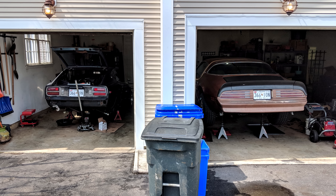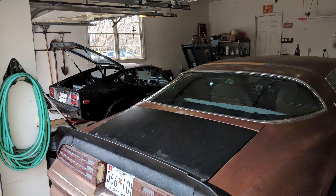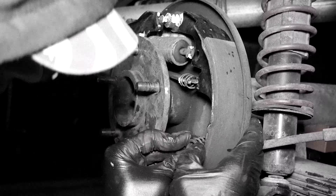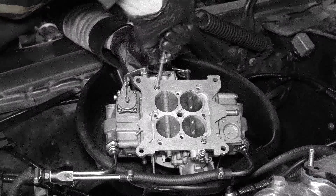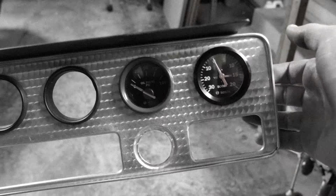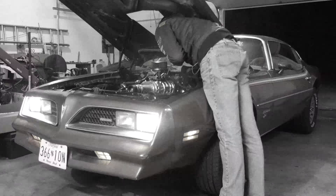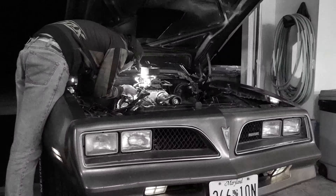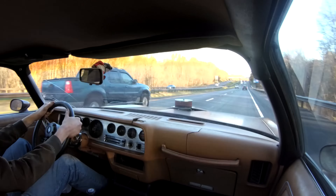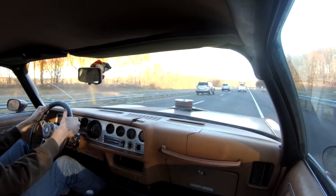But while Sean had always planned to bring the Datsun to this autocross event, I decided to bring my project car, this 1978 Firebird, as well. A small light car like a 280Z really lends itself well to autocross, while something much larger and at least a thousand pounds heavier like a second-gen F-body doesn't lend itself quite as well. But that's exactly why it sounds like fun. So in the week leading up to the event, we corrected the shoe placement on the rear drum brakes, installed a new set of tires, replaced a cracked carburetor base plate, got the transmission kickdown working, and installed some aftermarket gauges. There's nothing quite like a deadline to force you to get work done, so I was up tuning the carburetor and test driving the Firebird until 2 a.m. the night before.